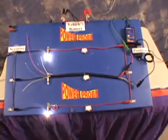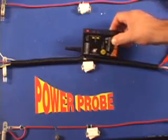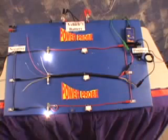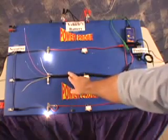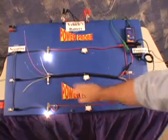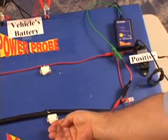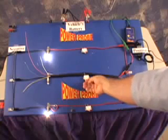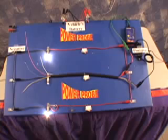Now let's trace the circuit again. The smart receiver now stops at the open switch. Here's a little tip. As you get close to the break in the circuit, try wiggling or flexing the wires to see if you can get it to make contact. Just like we're simulating by flipping this switch here. If it makes contact with a circuit to ground, you'll be instantly alerted by the smart transmitter's tone. This simple technique is called a wiggle test.